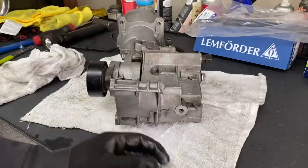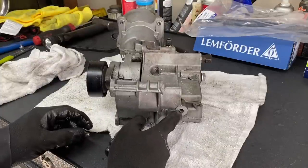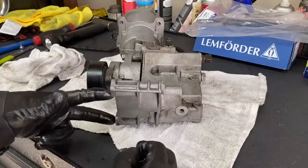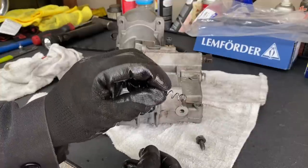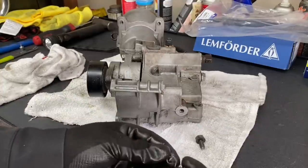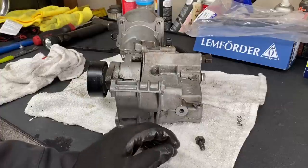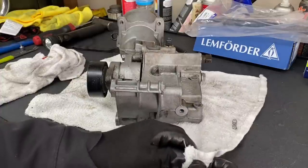So before we get too far on cleaning this filter housing, this is where the back screw for the power steering pump mounts to the oil filter housing, then the two other front bolts up here. Someone over torqued that steel bolt and they just pulled all this aluminum out. And so this thing is wiped clean. We could drill it and then we could tap it and then get an oversized bolt for it. But I'm gonna go to the parts store and I'm gonna look for a helicoil.